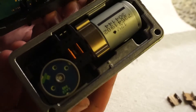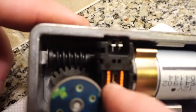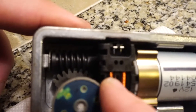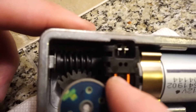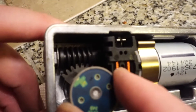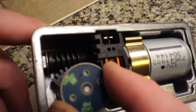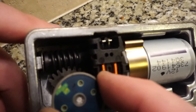Let's see if there's anything we can find from this. Now that we have the actuator removed, I'm able to find that I have a little bit of play in this worm gear. So it turns out it's a worn worm gear, which is causing some differences apparently. So we are going to be getting a worm gear rebuild kit. And if I can't figure that out, a replacement electronic actuator.